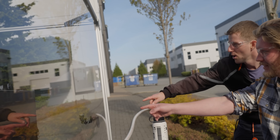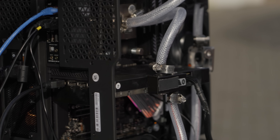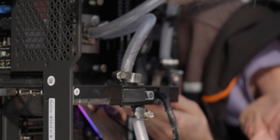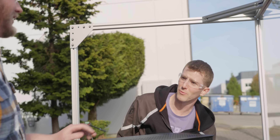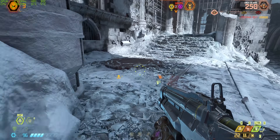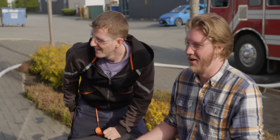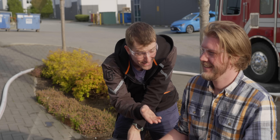Is the tubing starting to bulge? Are things leaking? The GPU block is leaking — I think it's bowing, Alex. Yeah, you can see it — it's bowed. I guess that's what 150 PSI will do for you. The people came here to see it run; let's see what temps we can get. 200 PSI! The GPU looks okay now — wait, it didn't even go down anymore, at 30°C. That's probably just the temperature of the water going up. Also the GPU block bowing might mean it's short-cutting the impingement jets.